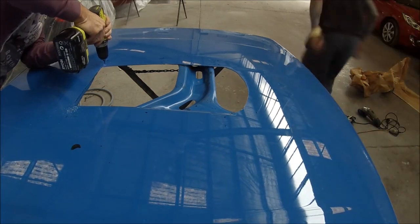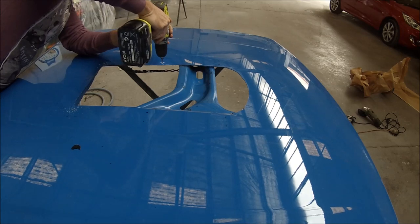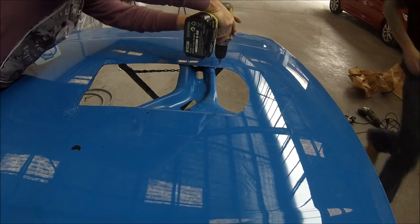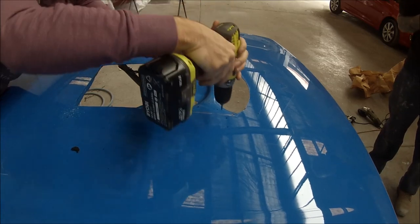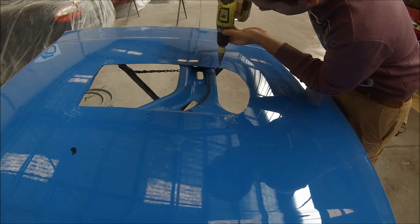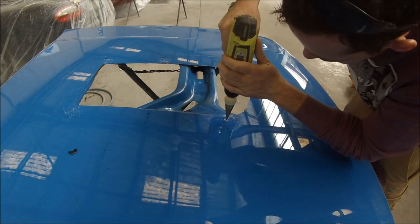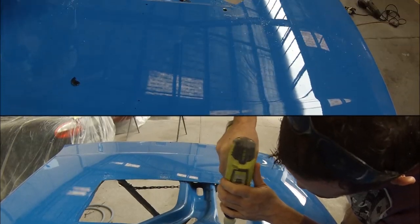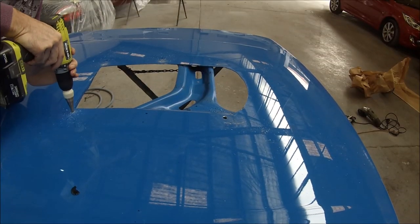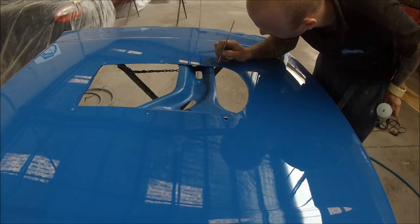What we're doing here is drilling the holes for the screws. If you look on the inside of the bonnet scoop itself, this one has got screw holes as well. So we're not only relying on those screw holes but we're also going to use some Sikaflex — that's the brand — it's urethane, black urethane, which is a high bond, high stick adhesive. Truth be told it would probably hold in there just with the urethane, but I'd rather put the screws in just to be sure.